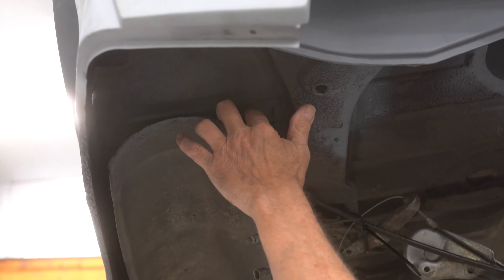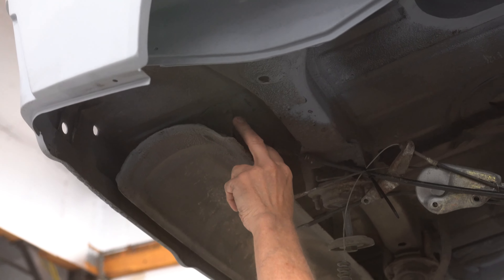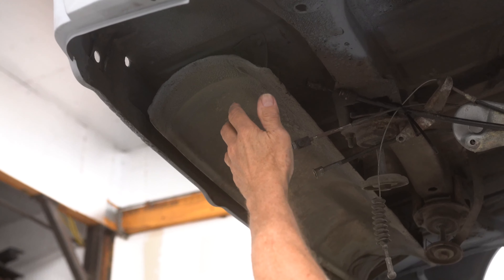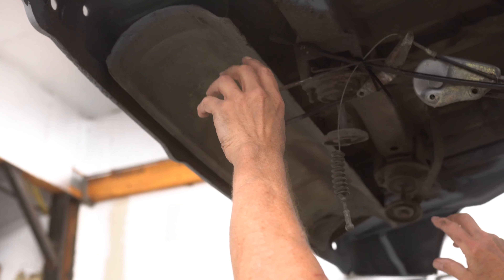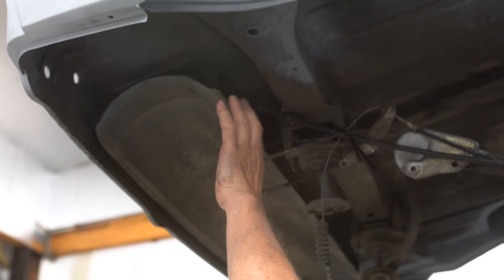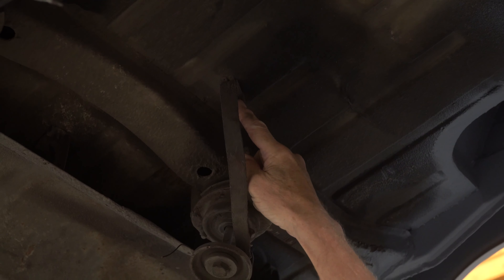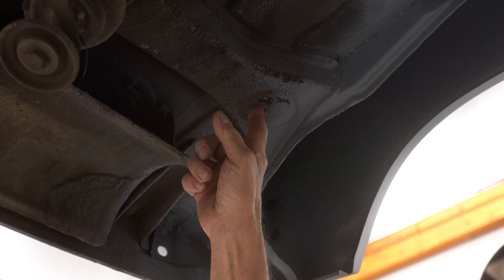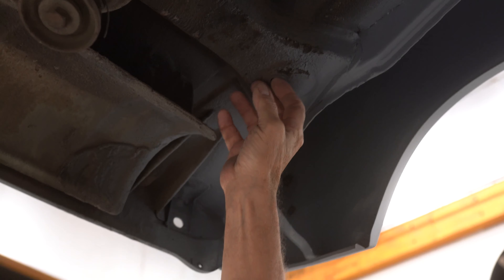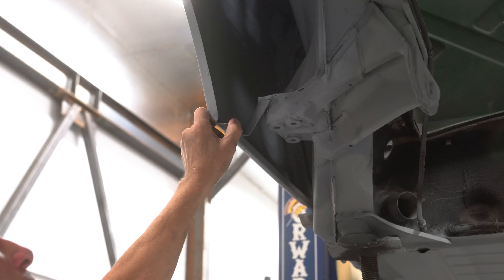The back of the car has a riveted-on muffler shield — that's a dead giveaway six-cylinder. The six-cylinder was the only one with a riveted-on shield. The Volkswagen factory welded all of these on for the four-cylinders, but when they sent these to Porsche, the six-cylinder muffler was of a different configuration, so they sent the bodies without them and Porsche then screwed on their own muffler support shield. Two rear transmission mounts. Again, the stud is critical for the grounding of the power plant right here. The two plugs — they were anticipating a rear sway bar; this is actually the plug for the mounting of the rear sway bar bracket right here. And the two shock towers on either side are the support for the rear quarter — make sure this is on if the quarter is going to move.